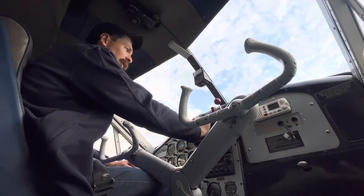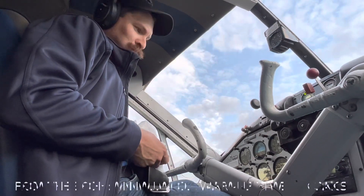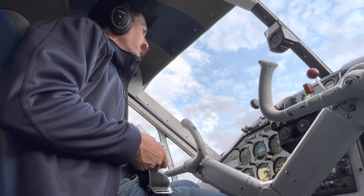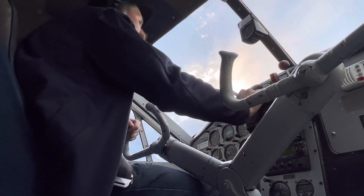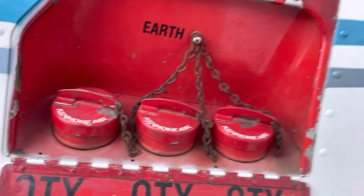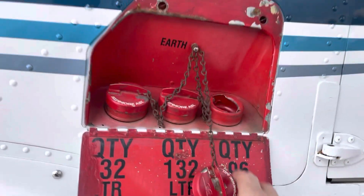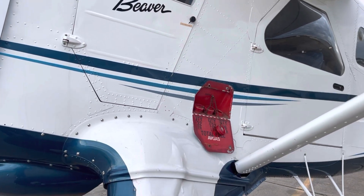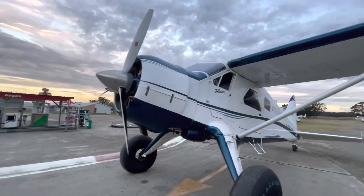While we wait for it to warm up so we can go around to the fuel bowser, we're getting fuel. We're getting fuel to the three belly tanks - the front one, the middle one, and the back one. I'm just going to fill up the back one for this five-minute flight across to Cessnock, only because if we filled it right up and then suddenly had to put a heavy load in, I wouldn't be able to take it. So filling it up gives us about an hour's fuel.